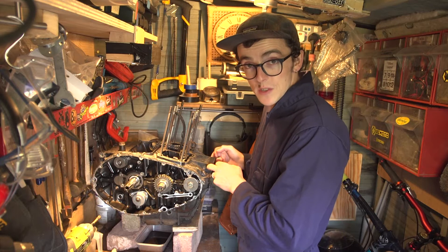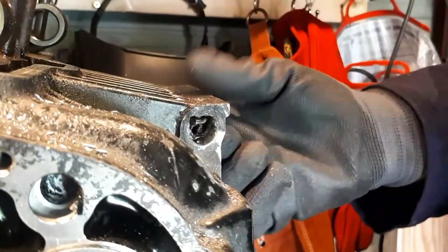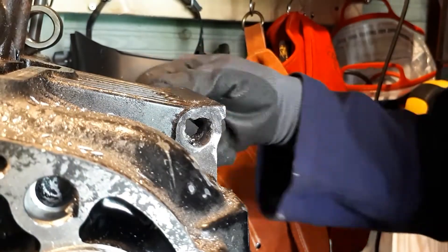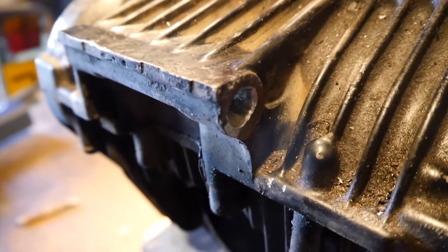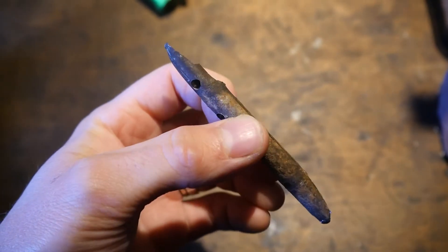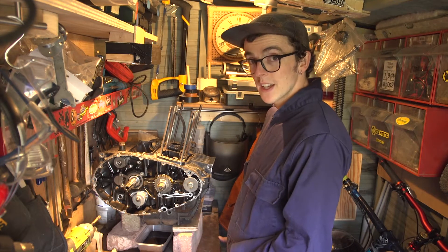It's a known issue and a lot of people have these issues getting these out, so I'm not alone. However, it's out. It was two full days of effort to get it out — I couldn't believe how difficult it was. It just chewed through my drill bits. I had so many different goes at it from different angles, but it was just chipping away at it with a drill. It's not pretty — I'll need to do some touching up — but it's out. I can get a replacement bolt, and now I can finally move on to getting these crankcases separated.